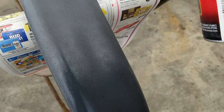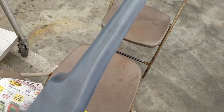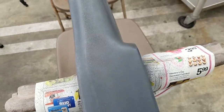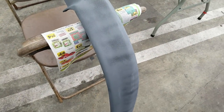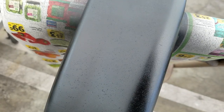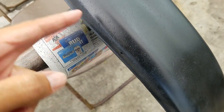I'm only looking for one light coat anyway. Alright, let me finish this up — that's basically all I'm gonna put, exactly like that. Just to get a little adhesion, let this cure 100%, and blow some base on it — it'll look pretty good at the end. Alright, waited about 20 minutes, fully cured. I'm gonna be using a SprayMax base coat and shoot it up real quick. Alright, so that's the first coat — it's gonna look kind of rough because it still has little indentations from rock chips, but I'm definitely not going for perfect, just looking for a little shine. Hopefully the clear will fill that stuff in.